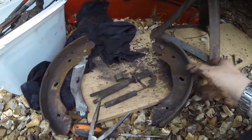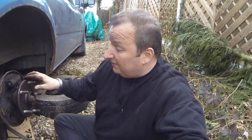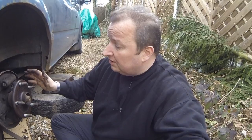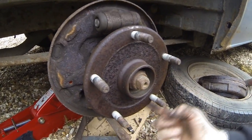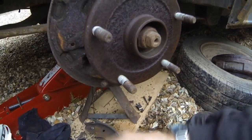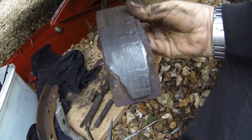I'm going to order a new set of pads now — a set for both sides — and clean all this lot out. As you can see, there are no leaks from the seals and the dust caps are all in good condition. I can't actually put it back together now, so we'll reinstall this lot in part two. I hope this has given you a little bit of an explanation on how to separate these things. There's very little on the internet about these apart from a few descriptions in forums. That's the sealing edge there — squirting your fluid in there will probably ruin the pads anyway, so be prepared to fit new pads. Thanks very much, see you in part two, bye for now.